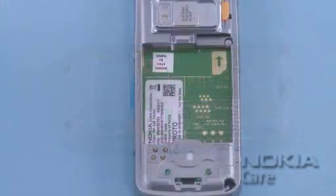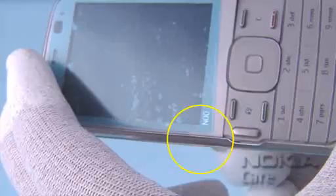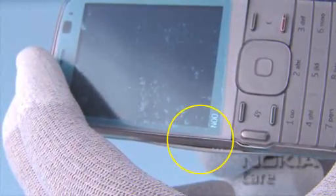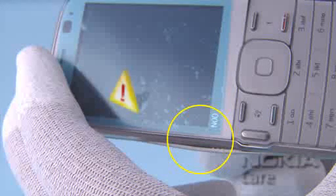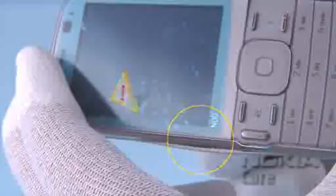To release the edges of the A cover, insert the SS148 to the battery slot, and rotate it clockwise, until you see a small gap between the A cover and the B cover. Do not fully rotate the SS148, as this would damage the B cover.